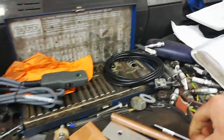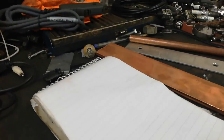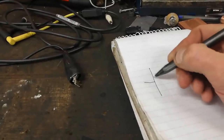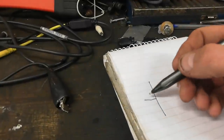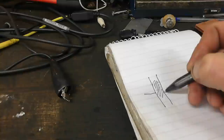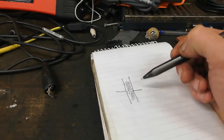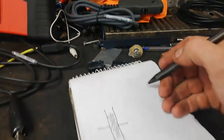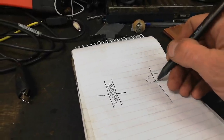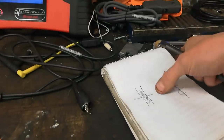We can demonstrate those two descriptions on paper. For the capacitor: imagine that is the top of your coil pack, and on the other side is your paddle. In between the two is your dielectric - that's your typical capacitor drawn there. That's your capacitive test. Whereas the other one with a coil, you're putting a coil around it in a current transformer style fashion around the HT lead there. That's capacitive, that's inductive - those are the two types of tests.